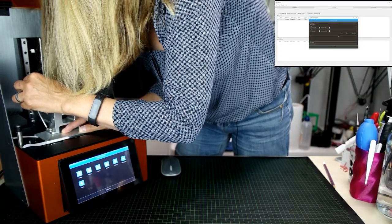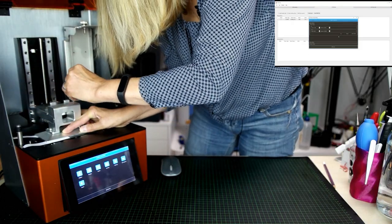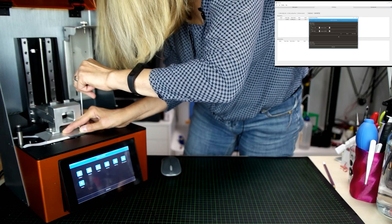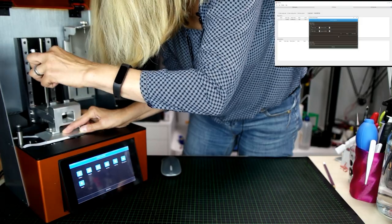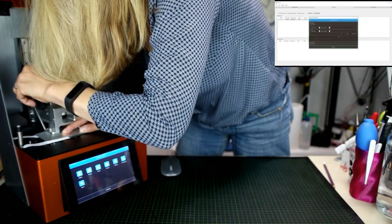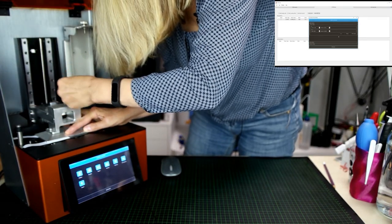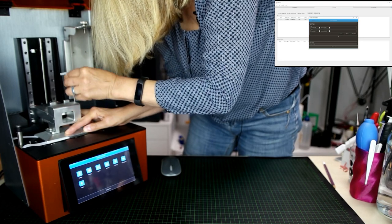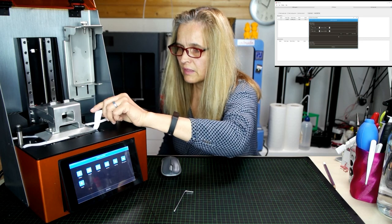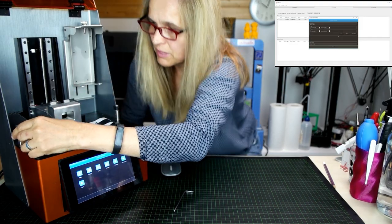And you see I'm doing it over cross. So if you're changing tires from summer to winter, you gotta do something similar. You always try to close them over cross. Okay. So now let's test if we are happy. You see, I cannot pull out the piece of paper anymore.